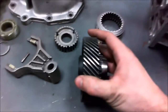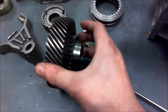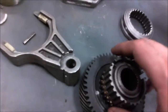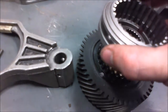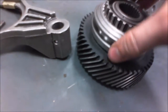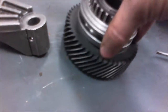This is one of the gears here. Right here is what the synchronizer hub would go onto. So when this is stored on here, a little bit like this, and then the hub, or the sleeve, goes on the hub like this. And then when you engage your gear, it will just slide down and lock the gears. Until then the gear is not locked, but once you go all the way down, the gear is locked.